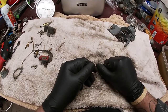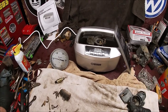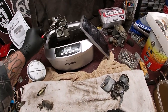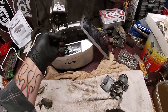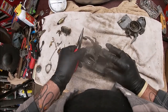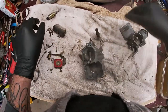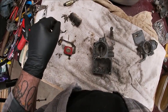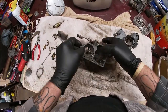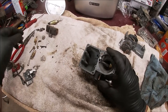Here is the fuel shutoff valve - your float comes up and hits this, and it shuts the fuel off going into the fuel bowl. These spacers have to be in, and you only need one but you have to have the right size. There's a way of measuring and knowing if it's the right spacer and if it's shutting off at the right time - that can be another video. Take your 14, snug it, don't go crazy. Turn that over - that is done.